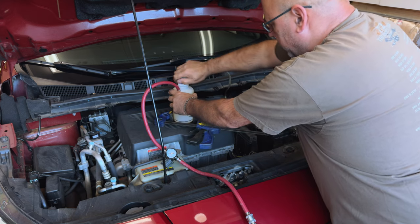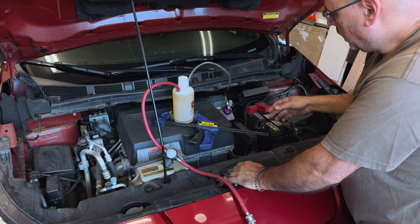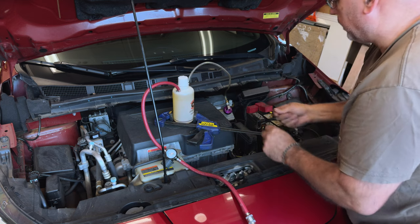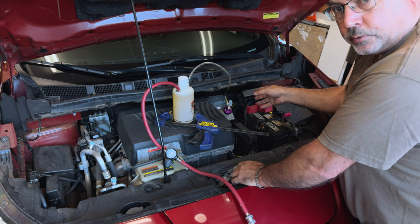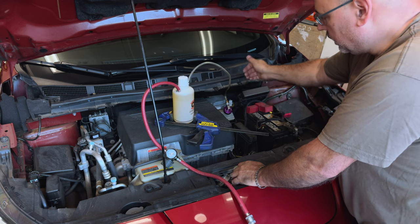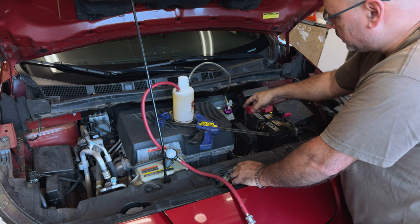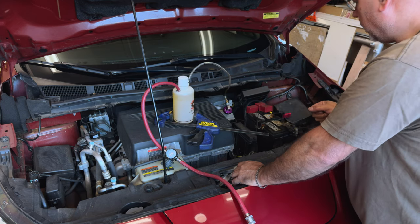There's a warning on this tube not to exceed 40 PSI. I think 40 would be risking things because this master cylinder is not really designed to take that. On most older cars, your brake booster is a big vacuum canister that provides brake boost. On an EV, which doesn't have vacuum or internal combustion, there's this big electronic unit back there — that's about $4,000 to replace. So if you want some motivation to take care of your brake fluid, that would be one of them. The brake fluid doesn't lubricate any of that — it's basically an electric motor and some sensors and some big springs.